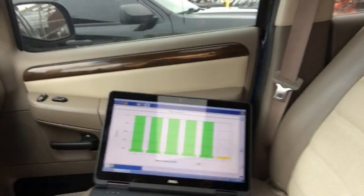We're going to show you how it sounds when you have low compression. This is going to help a lot of you out there determine if you have a compression issue. It may not be this bad, but you'll be able to hear the difference in cranking speed. You don't need a fancy scan tool like this to tell you there's low compression, so just take a listen and then we'll get back to the results.